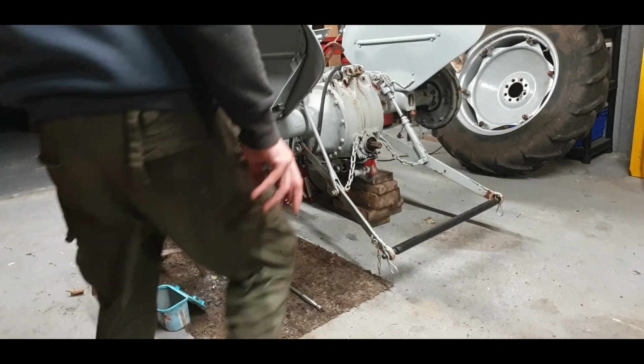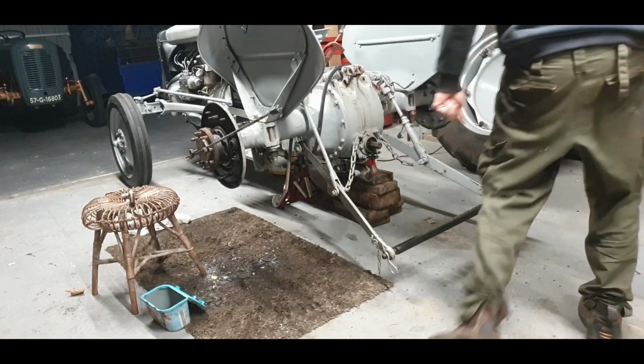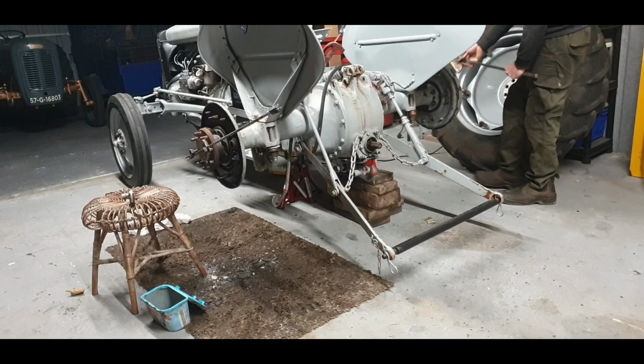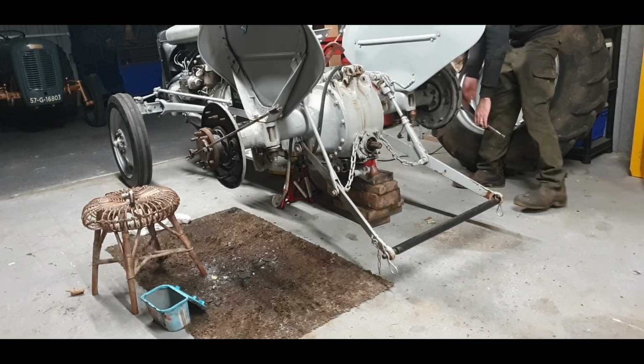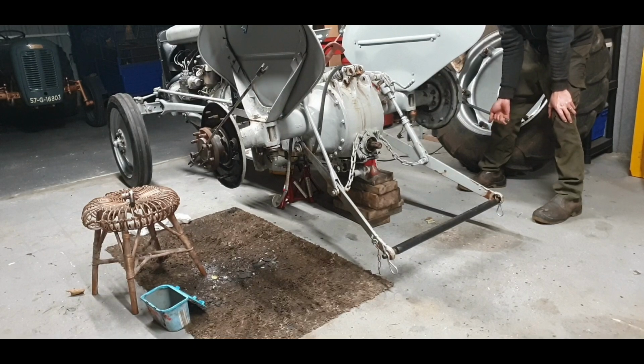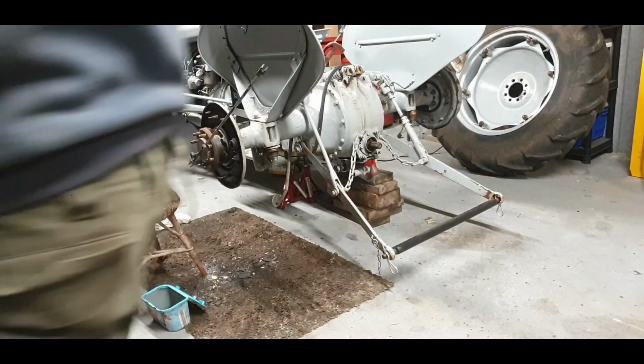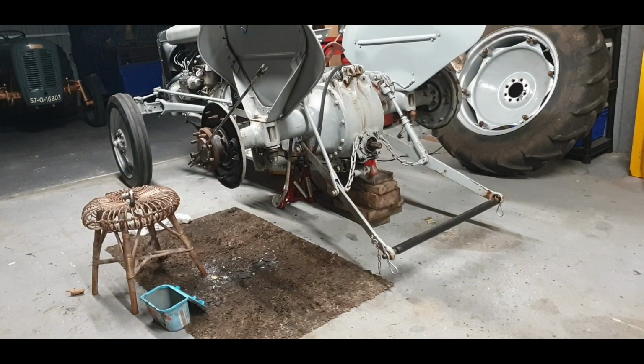So as much as I thought that felt nice, I did think it felt a little bit on the tight side. So when I do a test, it shouldn't turn the same way as I'm turning. And it is. The reason why that's happening is I took out the gasket on each side, I have to clean it back, I have no choice. So what I have to do is take that out again and put in a shim.